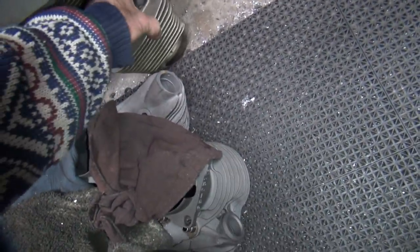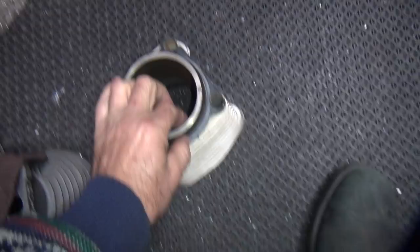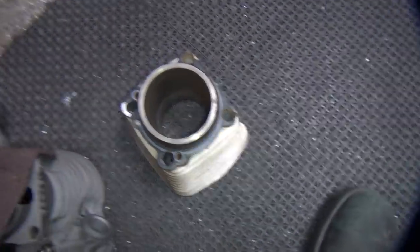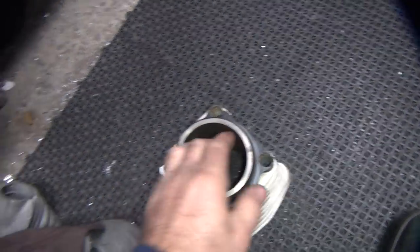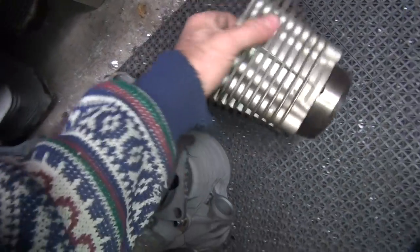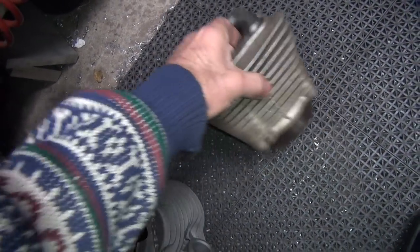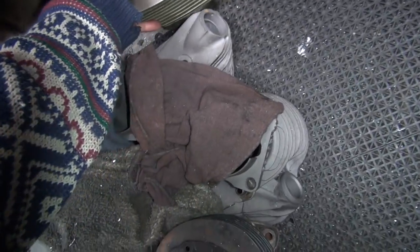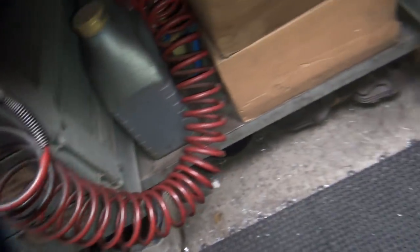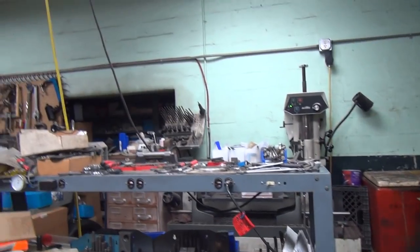You bore these things an eighth of an inch out - sixteenth a side - and it'll look like this cylinder when you're done. They purposely made these cylinders to be bigger, just like 883 cylinders. You can bore them a half inch because the cylinder walls are three-eighths inch thick. They charge you a lot of money for those bigger cylinders, but these small cylinders cost more to make because they're full of iron. It just gives you an excuse for Harley to charge more money for something different.